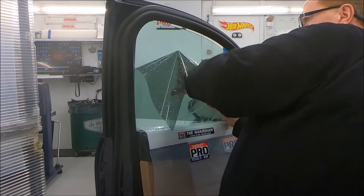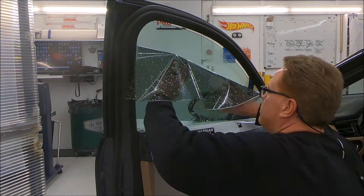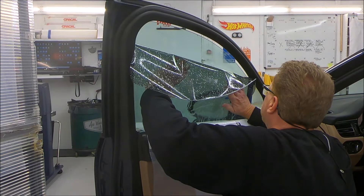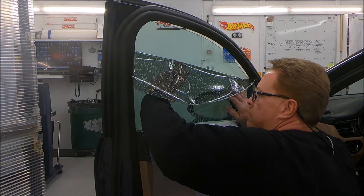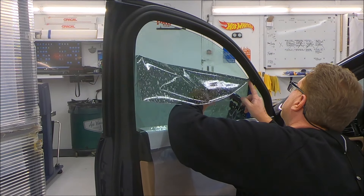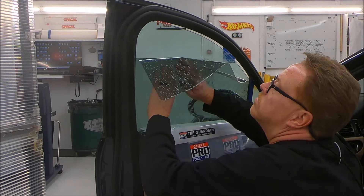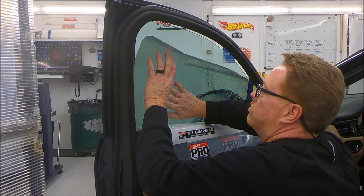No puckers, because if you do you can actually kink the film and have to redo it. We're putting ceramic on this so we don't want to waste any film. The key is getting in there simultaneously front and back without getting it all over the door frame. Once you get it in the front part of the seal, you push down on the panel covers with your palms — it opens that gap up and lets the film slide right in.